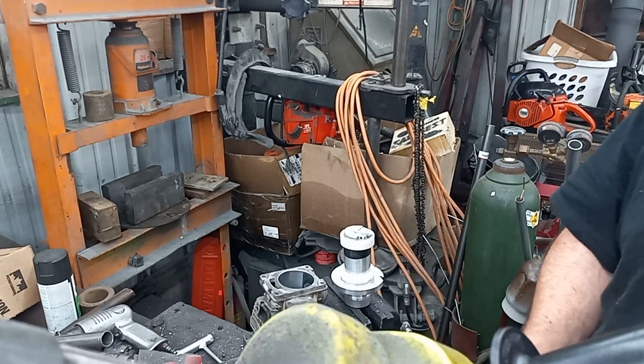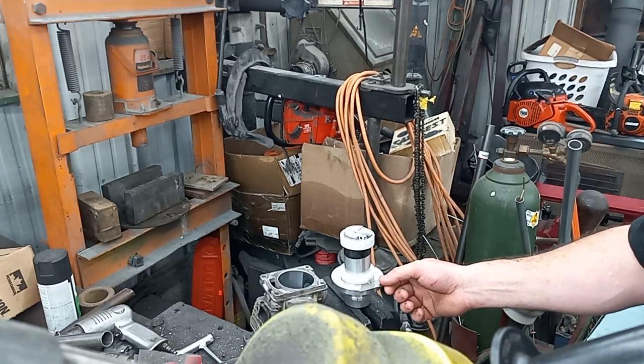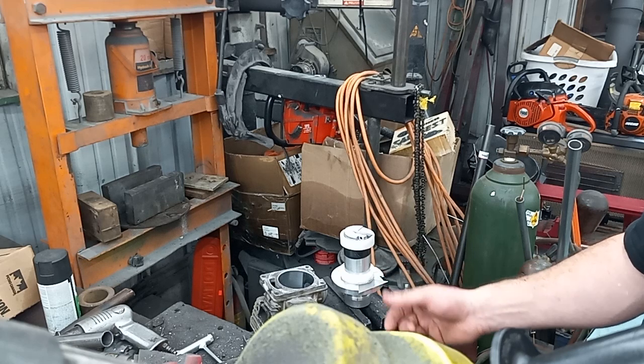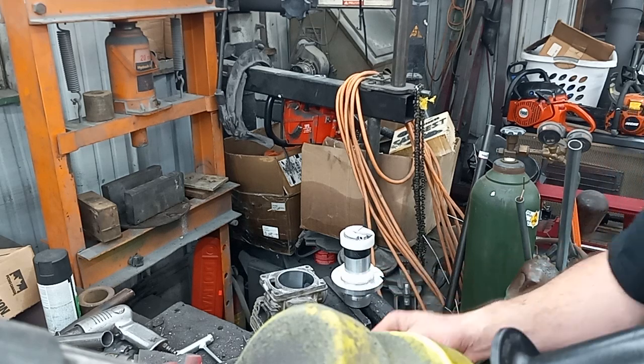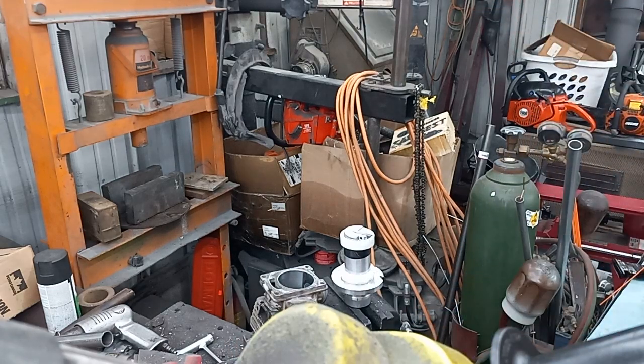Or I could find something that's 10 thousandths thick or whatever and add on to it with my razor blades. But typically, at least that brand of razor blade, some El Cheapo I bought, 2 of them are 45 thousandths thick. It leaves 5 thousandths if I want to sandpaper up that chamber.